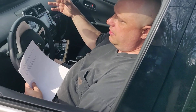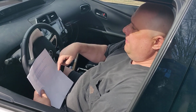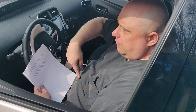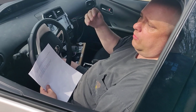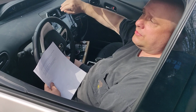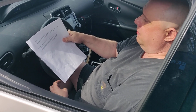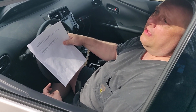but the act of lifting the handle tells this car to send out a key search, and that's a radio frequency, and it's very short range, right? So if the factory key fob is close, then yeah, it'll actually unlock the door for you and let you start the car, but if it's not, it won't. So what his little radio does is it receives the signal the car is asking for the key, and it relays it to the other guy in the yard holding his radio, and then that relays that signal and boosts it and sends it into the house, where your factory car key might actually be sitting, on a hook or on the dining room table or your kitchen table, wherever you put your car keys. Certainly it isn't within range of the car, but it would be within range of that guy in the yard's radio.